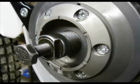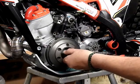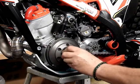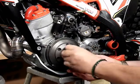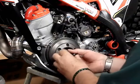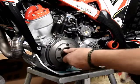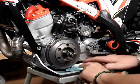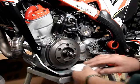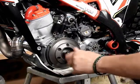And the puller tool actually is the same one as GasGas Pro, but only the electric start TRS bikes use this tool. The non-electric start bikes use a different tool that's not related to GasGas. Make sure the tool is fully seated, and then make sure that the bolt in the center of the tool is also fully seated, as I'm doing there.